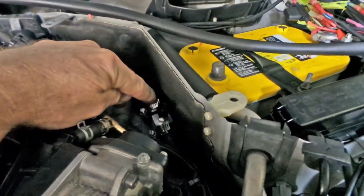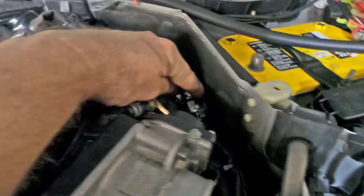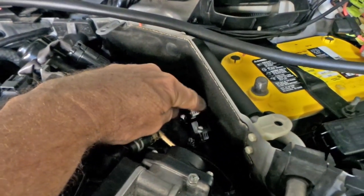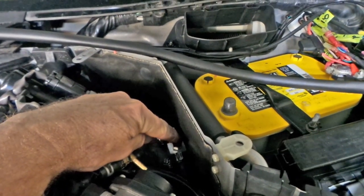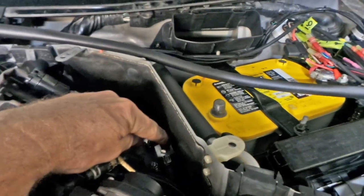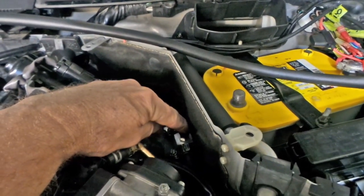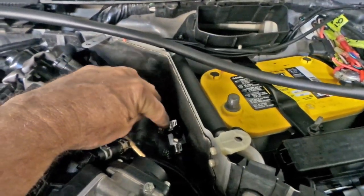which is part of the cooling system now. There was originally a plastic fitting here that had a bleeder on it so that you can properly bleed the system when you fill it. So I've just used an AN style cap onto that, and directly underneath this is a takeoff, which is part of the turbo water cooling. And it's very hard to get all this sort of stuff on and everything.